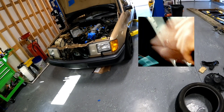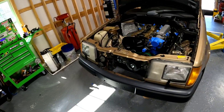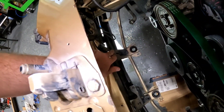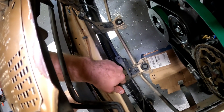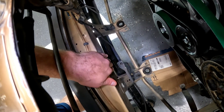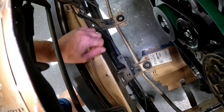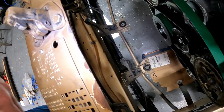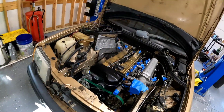To avoid all that, we're just going to run a recirc style — it'll keep the car a little bit of a sleeper; you won't hear the fast and furious noises. I'm going to try to hide the intercooler. I'm going to cut these two radiator support brackets and I've got some drop brackets coming, so the intercooler is going to fit straight down behind the bumper. I'll have to cut the bumper to make it fit, and then I'll have plenty of room for a radiator.